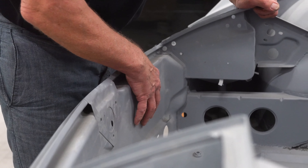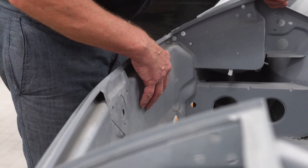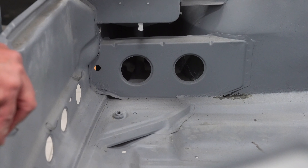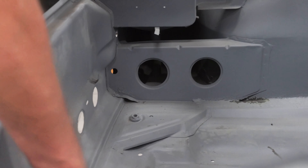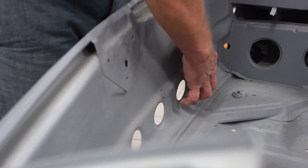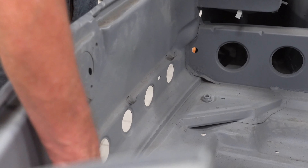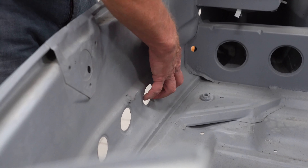The panel bump here is small for the 70, 71, and 72 models. It became larger for crash standards in 73 and 74, and then very much wider for crash standards in 75 and 76, reinforced. These front panels are no longer made, so when you buy a front panel, it's the later model, and one can instantly identify the fact that the front panel has been replaced. This is a 70, 71, 72 front panel.